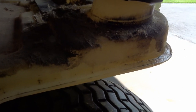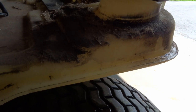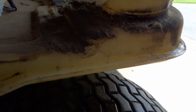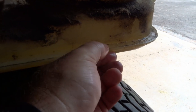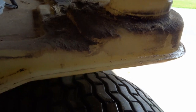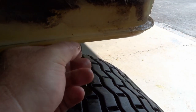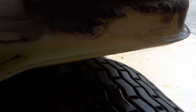I'm going to fill the tank to get the gas level above this seam and observe. Now I can actually pull this down and gas starts running out, so I know it's right in here. Some videos say use JB Weld, but I looked at a lot of videos and it seems like JB Weld ends up failing — especially on cracks. Maybe if it's a small pinhole it'd be fine, but we're going to do some more drastic measures. I'm going to jack up this side of the lawn tractor so the fuel is no longer at this seam.